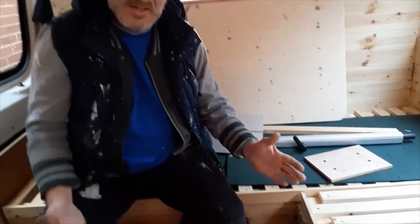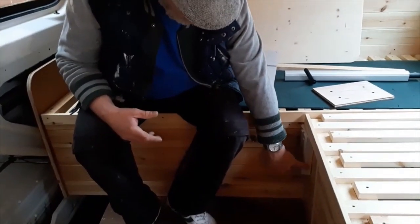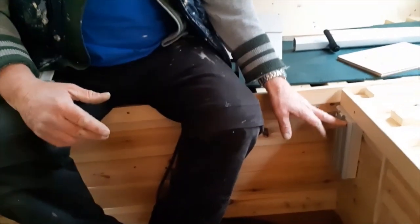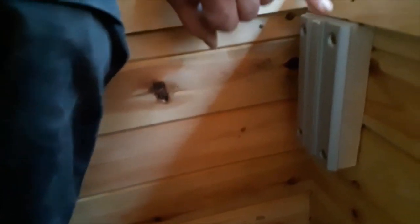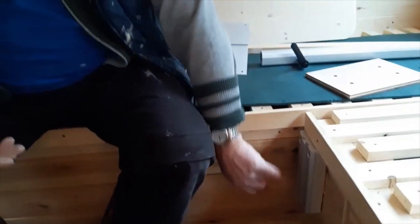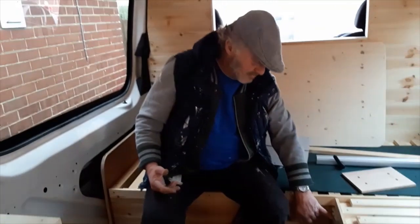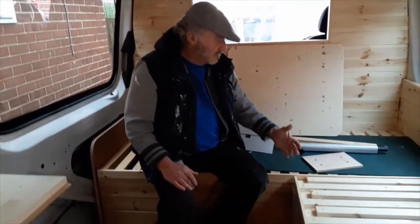However, because of where we needed it in the van, I've used a bit of old worktop cut off to create the depth, and obviously the bolts weren't long enough. Where it's situated, it goes through the 2x2s of the frame, so we've used some big heavy duty screws that go through all four holes, through the backing and into the 2x2, so that this bracket is clear of the frame. When our seats go on, you don't want to have a problem trying to load it up.